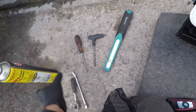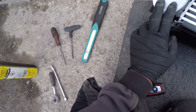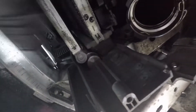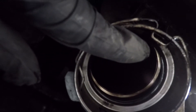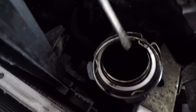I've already removed the old intercooler, so I'll show you how to remove it and put one back on. Underneath the car, the intercooler has two torx screws — one here and one on the other side — which go into the housing for the rad and the AC. You'll also find the intercooler pipe on each side with a clip that goes into the actual intercooler housing. What you need to do is get a flat screwdriver and take that clip completely off.